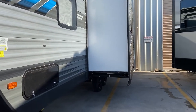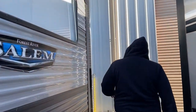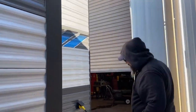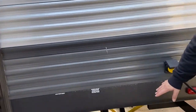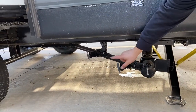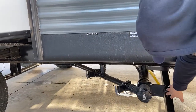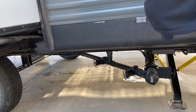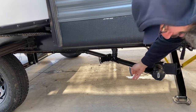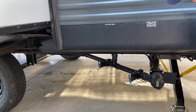Here's your power plug-in and your dump station. You'll notice the handles are color-coded: gray is the sinks and showers, black is the toilet. Dump the black tank first; when it's finished, go through the rinse operation and close it. Then open the gray — it'll rinse your hose out since that's just sink and shower water coming through. Let's go ahead and head inside.